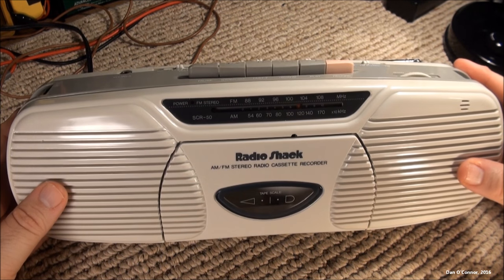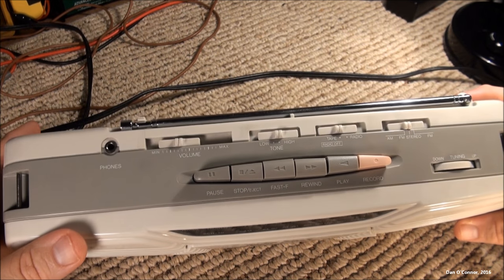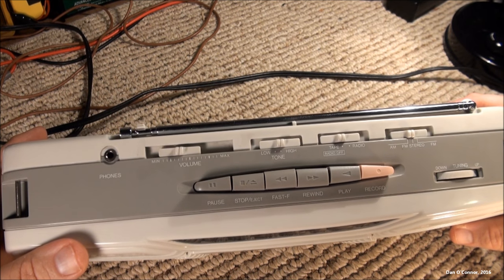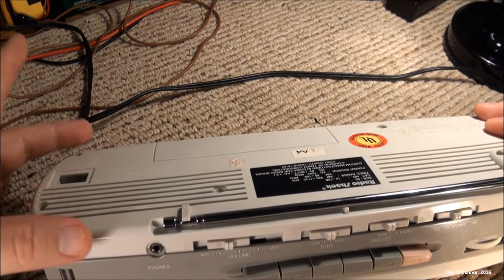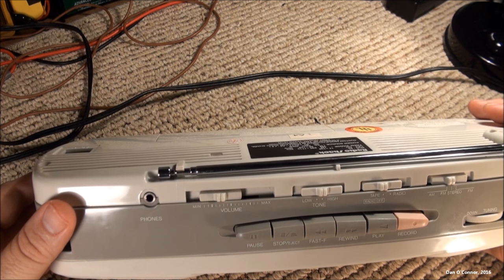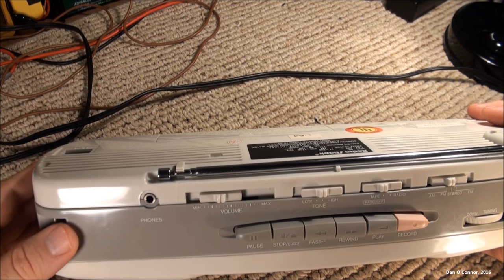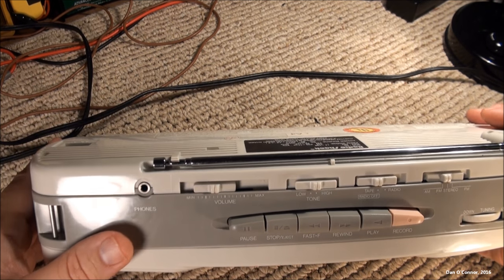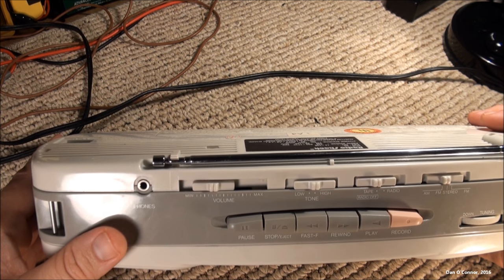When I got it, the right speaker did not work at all, and the left speaker just had crackle in it. So I wanted to go in and do some maintenance on the volume control. In trying to open it up I had a problem — it hung up over here. I could not get the whole back off and it gave me a lot of grief for about an hour. I finally gave up, but I was able to get it spread apart enough to get the fader spray nozzle in there, and I took a little video of that which we'll insert here in a moment.